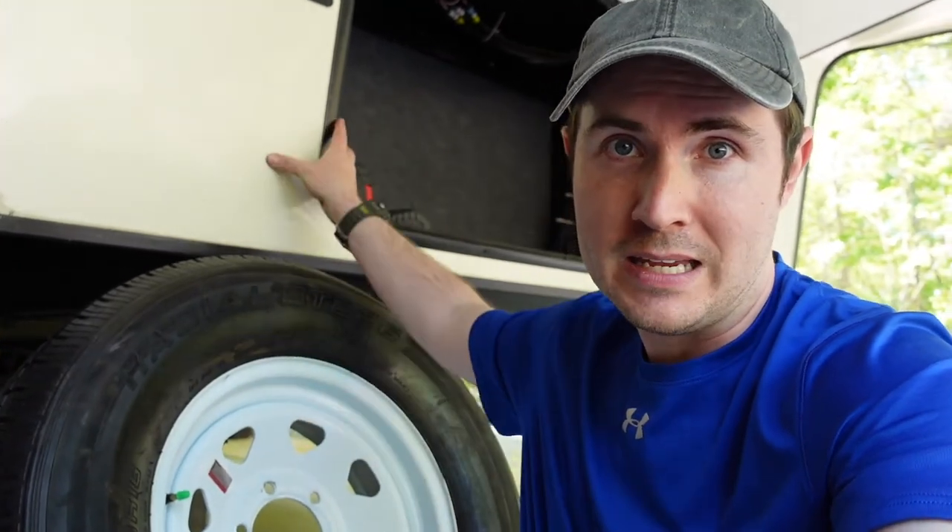For me, I thought about it and said I really don't think I'm going to be mounting and unmounting this spare tire frequently. I'm aggressive on checking tire pressure and monitoring it on the rig, and I'm always careful not to exceed the weight on the axles and tires. So why spend a couple hundred bucks or more on a spare tire mount I'm probably not going to use that frequently, if at all? That's what led me to just keep the existing spare tire mount from the inside storage and relocate it underneath — I only had to spend a couple bucks on the bolts.